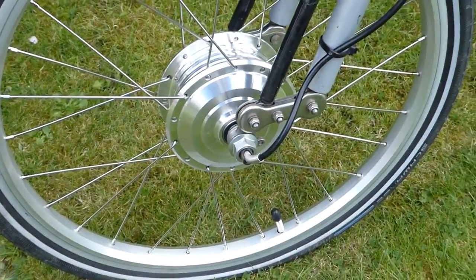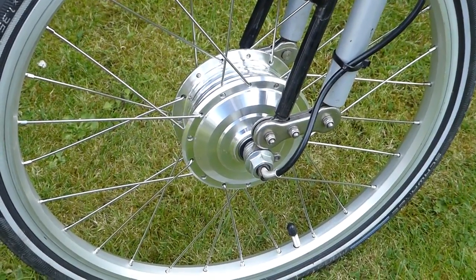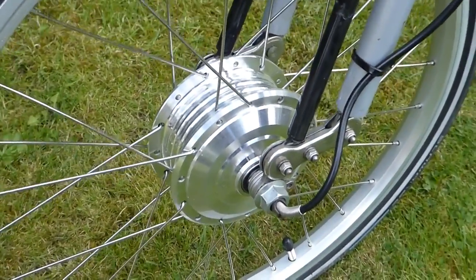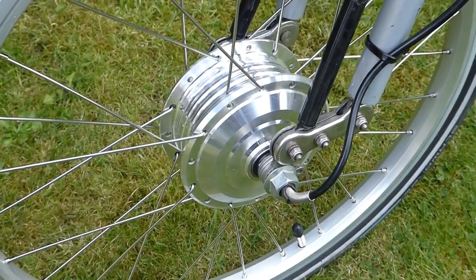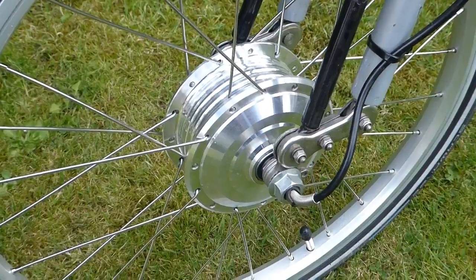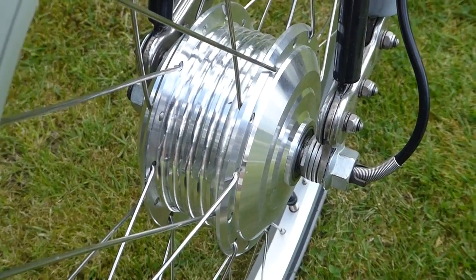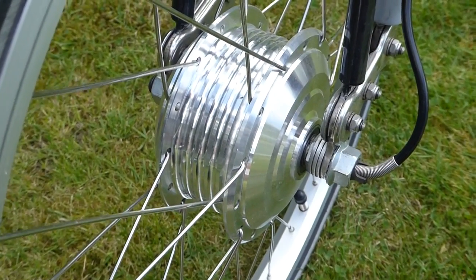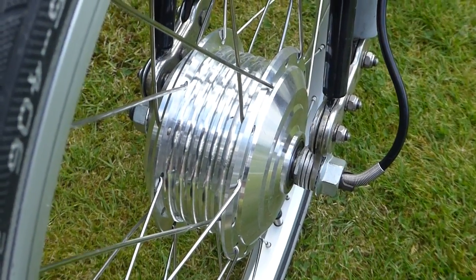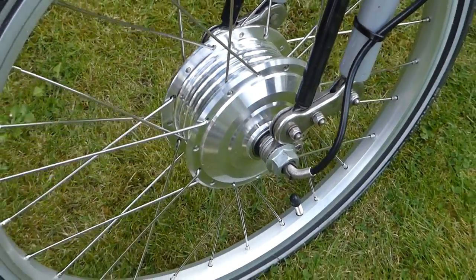Here's the nano motor itself. It's actually a friction drive — a brushless motor but it doesn't have gear teeth. It has a clever system that depends on rollers pressing on the outside of the hub shell. It's only about two kilos and around 80 millimeters wide, so for bikes with small dropouts in the front forks like the Brompton it can be fitted quite easily without too much adaptation, and as you can see it fits quite easily into the front forks of the Moulton.